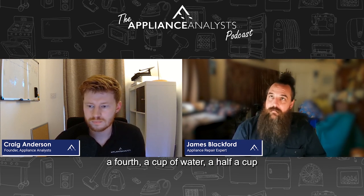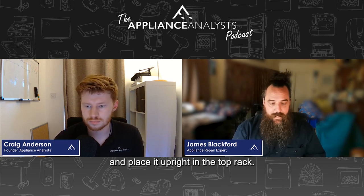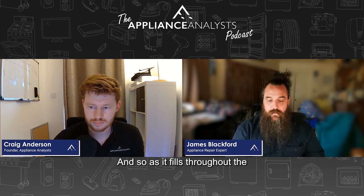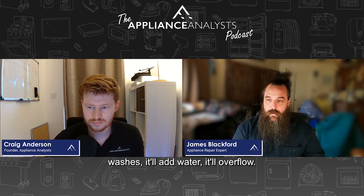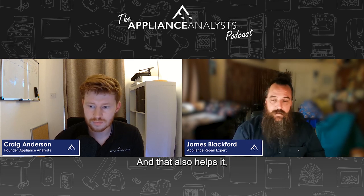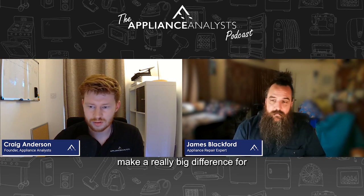The other bit of advice is to get something, maybe a teacup, that can hold a fourth of a cup or a half a cup of water. Fill it with regular vinegar and place it upright in the top rack. As it fills throughout the washes, it'll add water and overflow, so it's slowly releasing vinegar throughout the wash. That also helps it clean and dry as well. Doing those two things makes a really big difference for hard water areas.